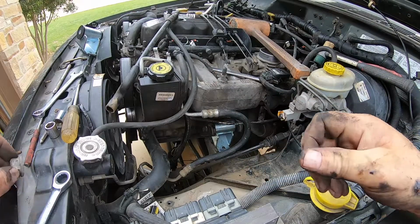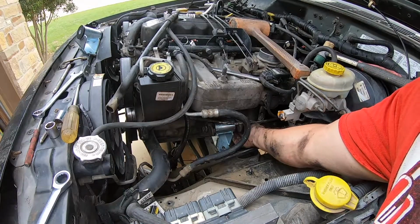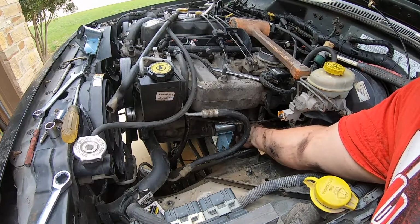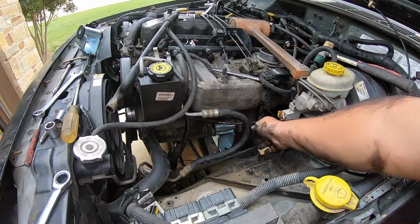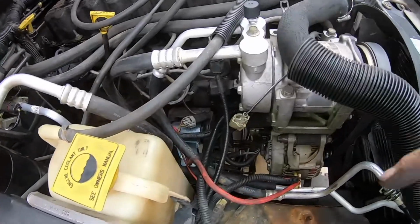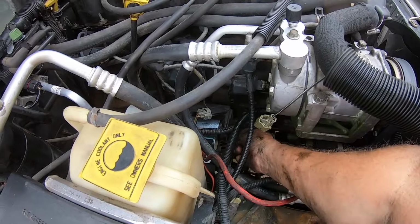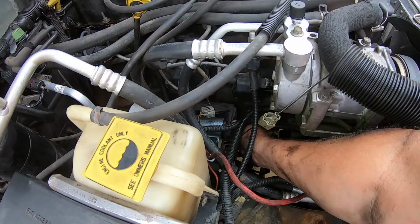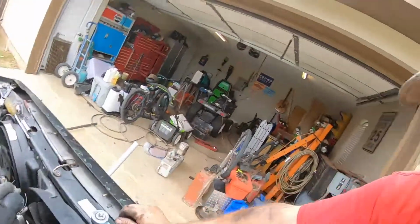Yahtzee. This side doesn't need any modifications to the engine side mount. The engine half doesn't need to be modified at all. Just go ahead and throw that mount in. But expect there to be alignment issues.